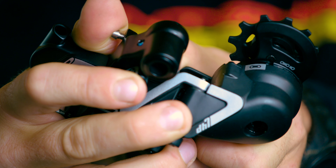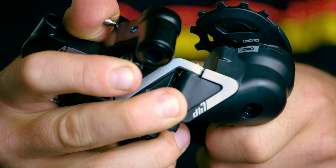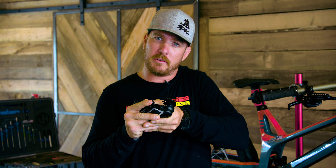On the cage, you're going to find two chain lengths. What you're going to do is just line them up in a little window together when finding or determining the length of your chain and cutting it.